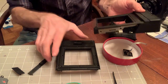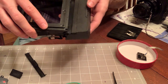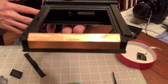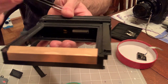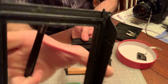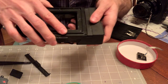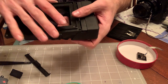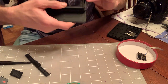The first step is to assemble this new top. We begin by looking at those 2 little notches. They should go into these 2 notches, kind of 2 holes. I'm going to point them out with a pair of tweezers, one here and one here. So those 2 plastic protrusions have to go there, and they slide in pretty easily. And the lab kind of sits, and you should see pretty well there should be no gap on either side.